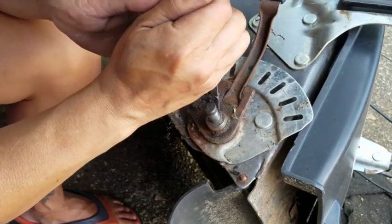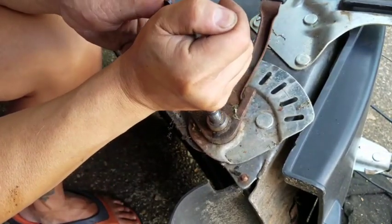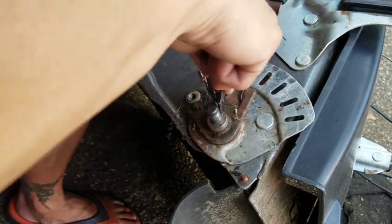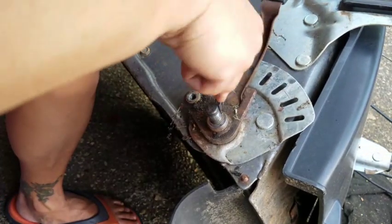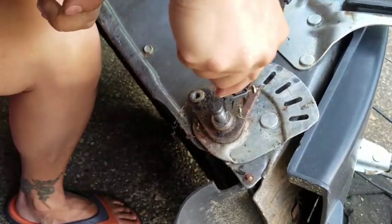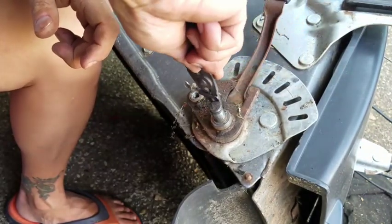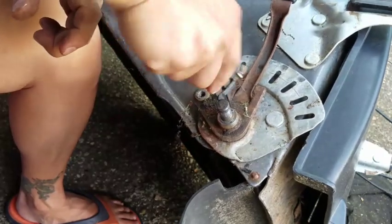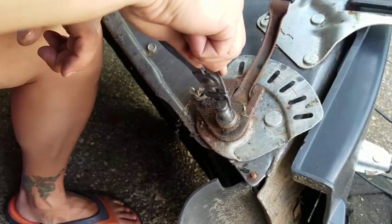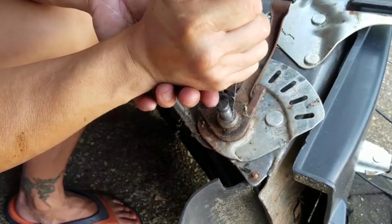Why? Oh, right. Because I need to figure out what's wrong with the transmission and at least try to get it so it'll go backwards. And I've been watching a bunch of YouTube videos on how to do that. Apparently it's notorious for a plastic sleeve that's in there that grips onto the transaxle. These holes are blocked with stuff, man. So I can't even pull this out if I wanted to right now. And so we have to smooth out the transaxle.